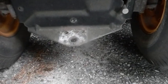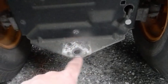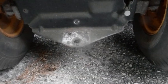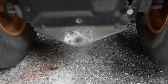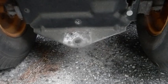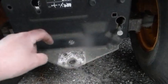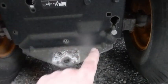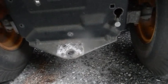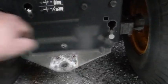Instead of putting a ball on there, I could see it looks like they had a tongue on there — it's probably sticking out. I would definitely bend it down. I'm just going to get a little receiver tube, dig through the stash, and put a plate on it. So it'll be a plate on the bottom, bolt it on, put it across the back, bolt it through. And I'll probably just put big washers on the back. That'll be fine for what I'm doing, and it'll straighten this up and gusset it too.